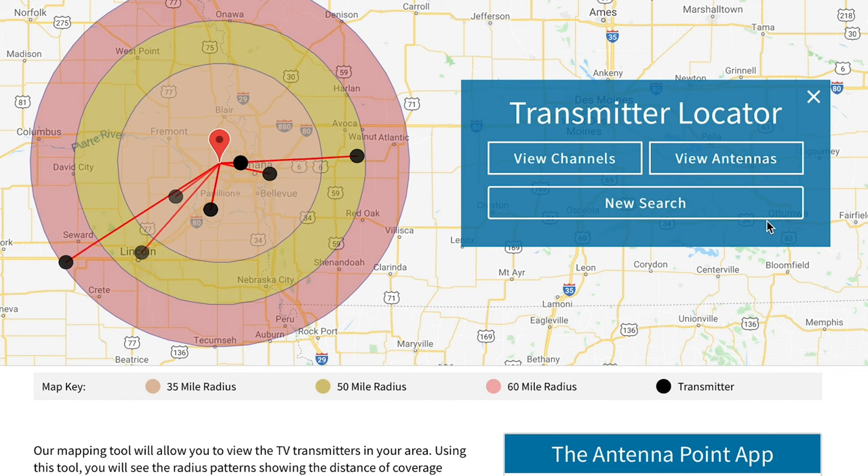And once you select a digital antenna and get it into your home, you need to figure out where to put it. Obviously it's going to be near your TV, but the direction you point it makes a big difference. You've heard the old adage, location, location, location about real estate — well, it's also true about digital antennas. You need to point your antenna in the direction of your nearest broadcasting tower. Going back to the Antennas Direct site, you can see little black dots on the map. The red locator dot is our house, and the black dots show where the nearest towers are. Since the nearest one is southeast of our house, we want to place the antenna high up and facing southeast to get the best reception.